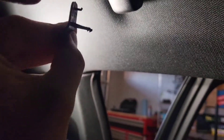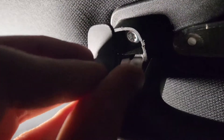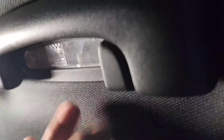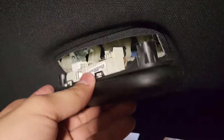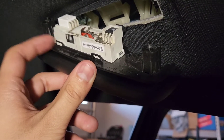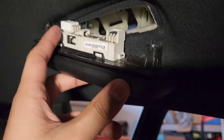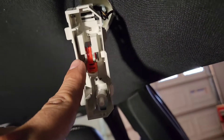For the rear light, you're going to have to take this clip off right here — just pry it out. Then in here you're going to take this bolt off, both of them, so we can take this panel off. Once it's off, you want to unclip this housing from where you grab — two clips on the back. So the housing comes away, then you pry from here, it comes off, and you'll be able to remove it and put the new one in.